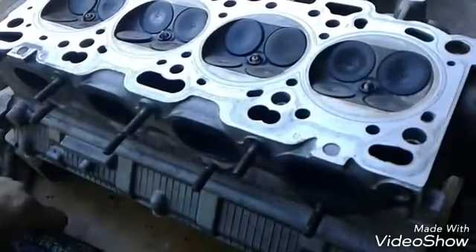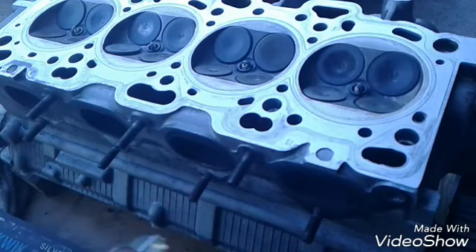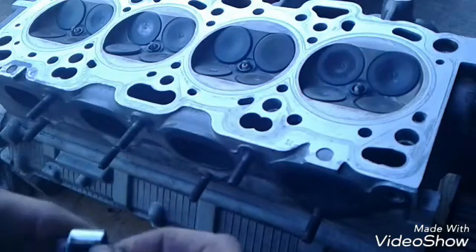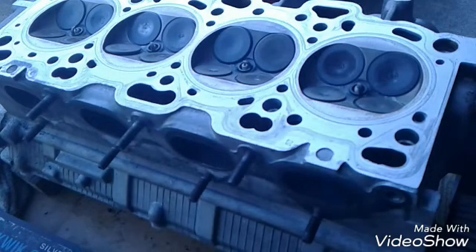That's all you do: check it in different angles to make sure there's no warpage anywhere. Clean the gasket surface off really good, use a straight edge and feeler gauges — that's all you have to do. One thing I wanted to point out: whenever I go back together with a cylinder head that I haven't surfaced, I usually use copper spray. It's a spray sealant that comes in a can, available at any auto parts store — spray it on the cylinder head gasket before you go back together. Anyway, if it helped you, please like and subscribe. Thanks again.